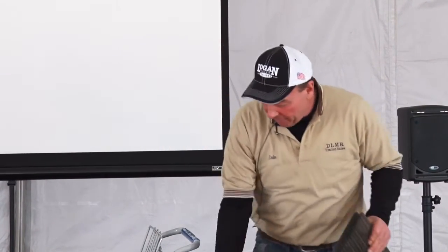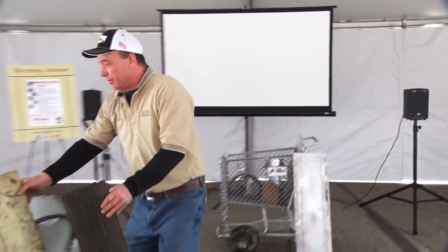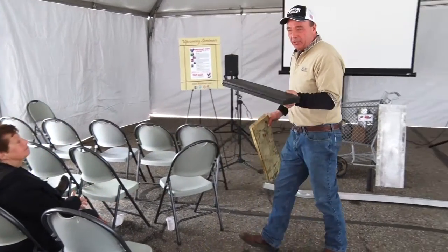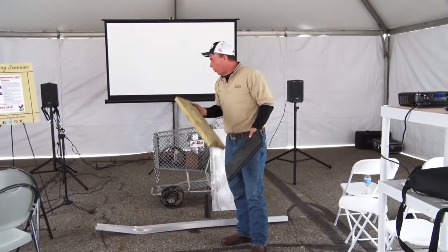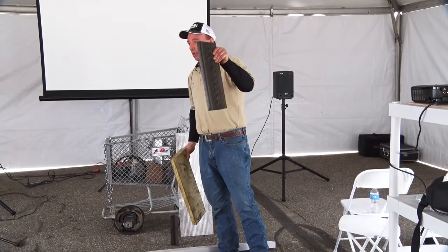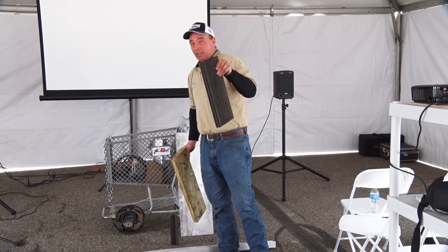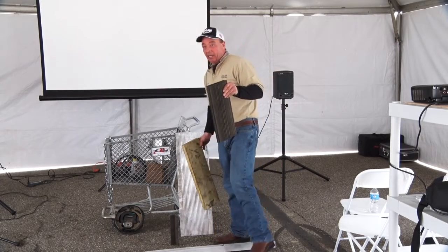And it's very heavy. I mean, this is a piece of wood, and if you feel the difference, big difference in there, okay? Problem is, you would think that this is plastic rubber, it would be as strong as this board. They actually have to put floor joists every foot if they're going to put this floor in. So you just add more weight into your trailer. So this floor I don't really recommend, to be honest with you.